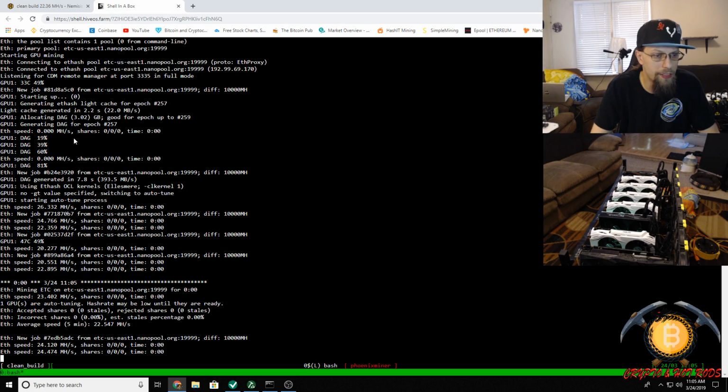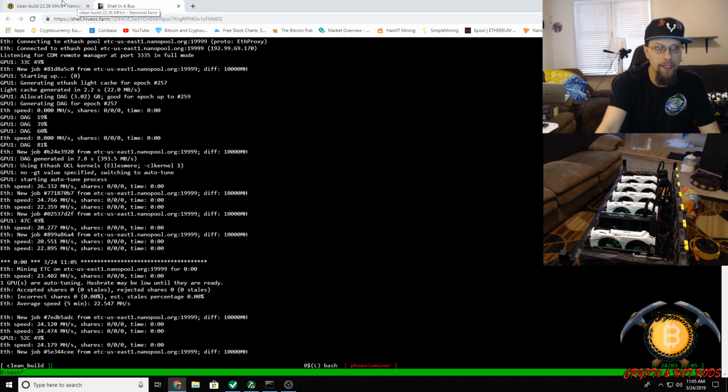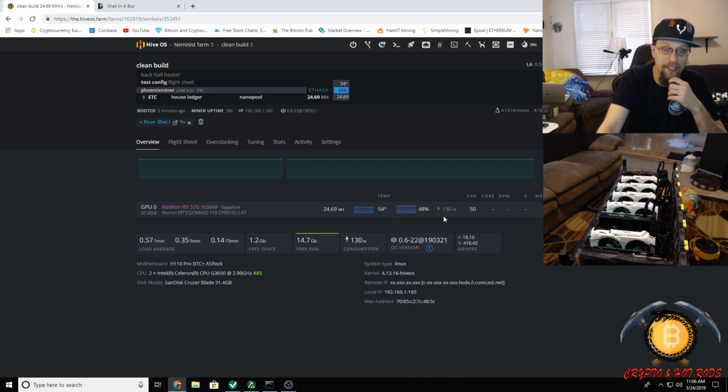So it looks like she should be starting to settle in here just a little bit. Now remember, this is a 570, so we should be seeing 570, 580-ish speeds. So we know it's definitely working. We're getting 24.47 mega hash in stock settings. That's not bad, really. I got 50% fan curve on there, so staying pretty cool, 52C. I like this. We are using 130 watts to maintain this though.